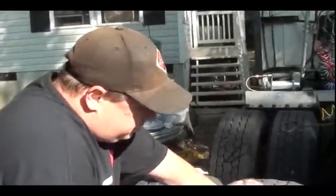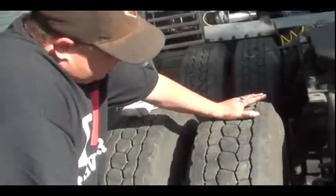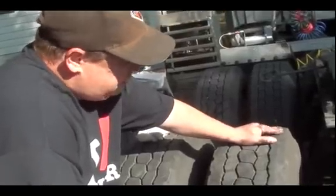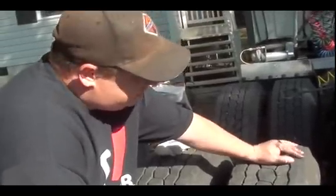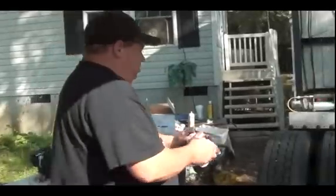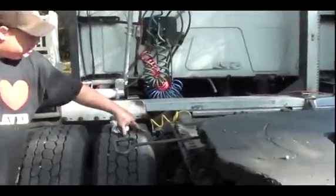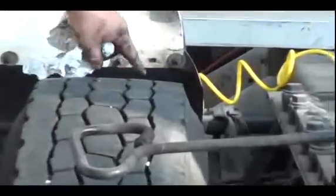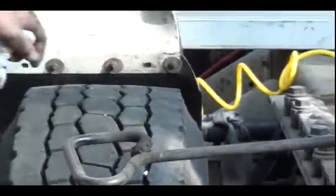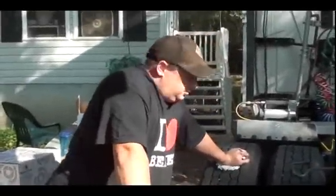These tires have more than 210,000 miles on them, so that's actually not too bad. It's quite normal. If it gets really bad, a severe step, then you may have too much in it. This axle here is a little tighter. It's got less in it, but you can still see a tiny bit, and it's walk. You got a little bit of walk in it, a little bit of waviness in this one, but at 200,000 miles, if you start to see that, it's quite normal, especially with these newer axles.